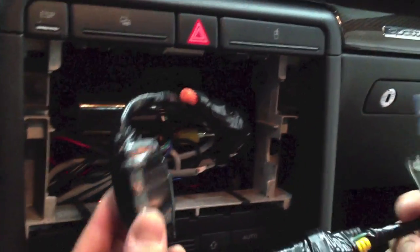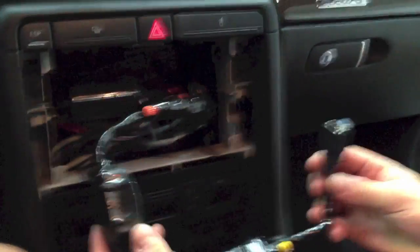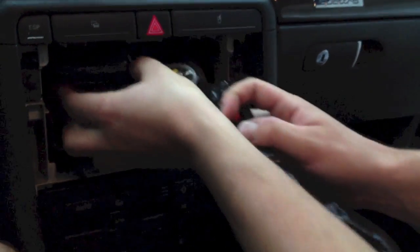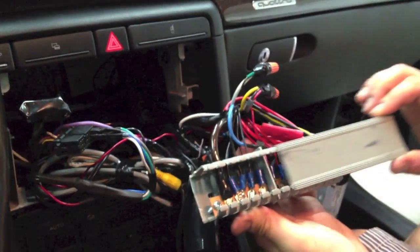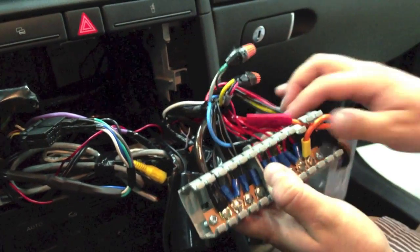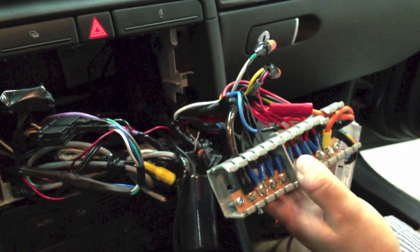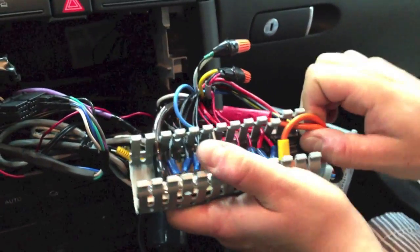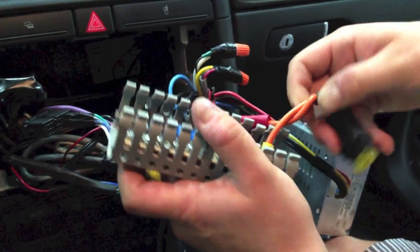There's a lot of stuff in the back here — there's probably one kilometer of wire. If I pull everything out, I'll explain in detail what everything does. This is my power bar. There's a lot of components, a lot of different things that use power, so I needed something to control all the power. The black is the negative, red is my positive. I've added my own fuse here, just in case the system fails.